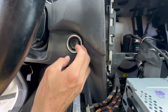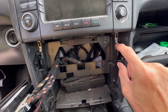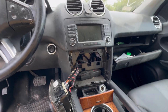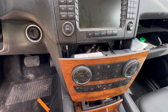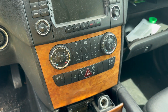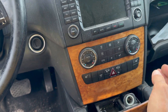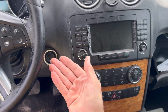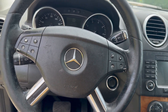We fished it back into place and now we're just going to close the ring above it. This part we took out after sliding those two things lower, then you slide it from the back upwards. There were two screws holding it right here. We're going to put them back — after placing those two screws that panel slides back above. To put it back, clamp the top first and then clamp the bottom in. Thank you guys for watching — this is how you do all-key-lost for an 08 ML 350.